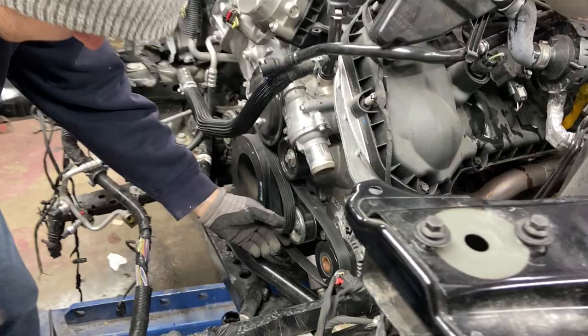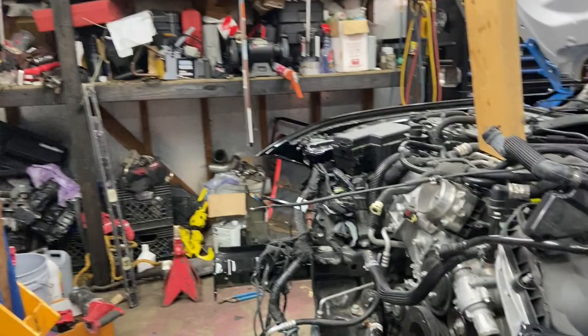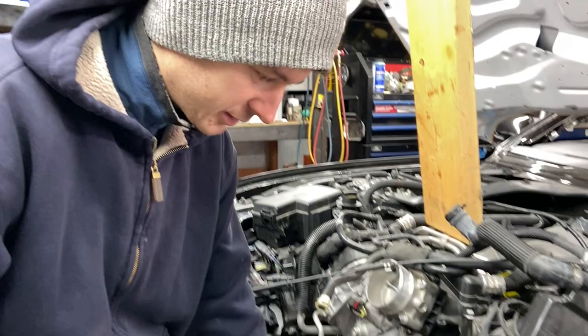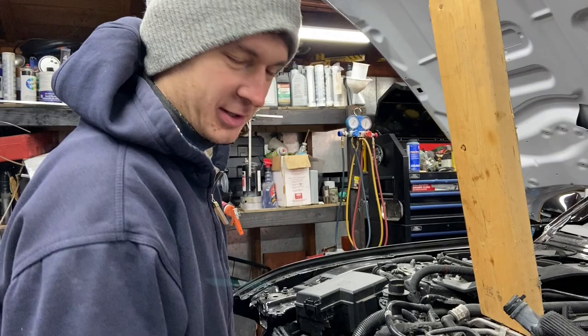John, how long did you stare at the belt before you learned the whole thing? 0 seconds. Were you traumatized at the time? It was a time when I was traumatized. I'm joking. Sometimes if you don't route it the right way, you end up with a slack in one part or on one side, and you realize what's going on. It looks exactly like it used to be, but you have to reroute the entire thing and you're fine.